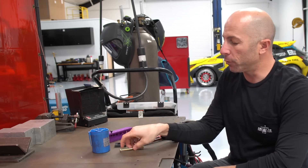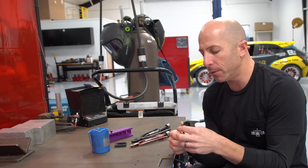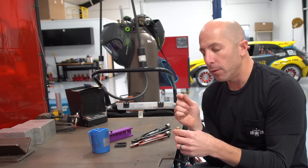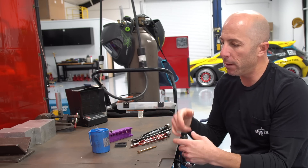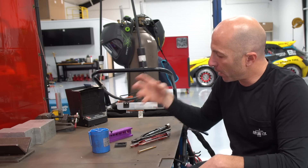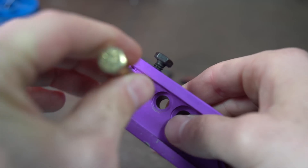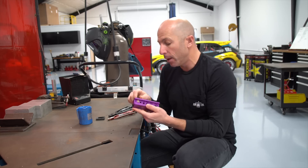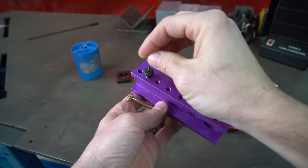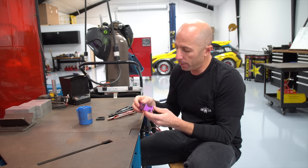The next thing is the bolts. We don't always have bolts that have holes in them like the high-end Army-Navy stuff, so we'll drill the bolts to put the hole in. I've got a couple of fixtures here because trying to hand-drill a bolt is really hard to do. So you have these relatively inexpensive fixtures — this one is from Speedway. You put the bolt in the fixture, there are different hole sizes depending on the bolt size, the screw holds it down, and the screw actually has a hole in the center. You fixture it up and drill the center of the bolt.